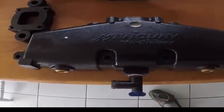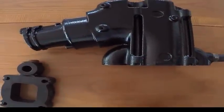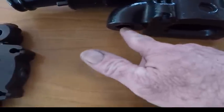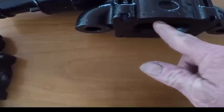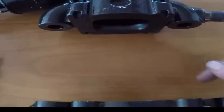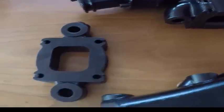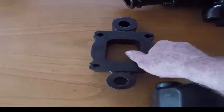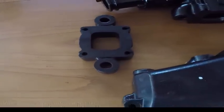This is a manifold for an eight cylinder standard MerCruiser and the riser. Now this happens to be MerCruiser's dry joint — they call it that — and it has to do with these two water ports. In the old castings the water ran in a pocket right outside of the exhaust chamber, and now they've separated that quite a bit. The water flows through these cast-in pipes basically. We'll also be adding a spacer. This particular boat needs a very hard-to-get spacer — only MerCruiser has it. Most spacers are three inch or four inch; this happens to be 1.75 inches, which made the whole assembly much more expensive.